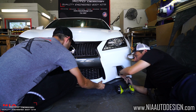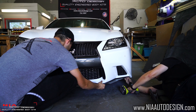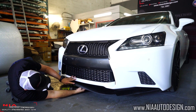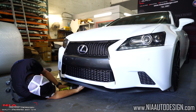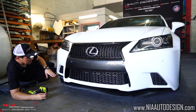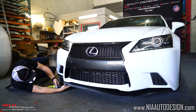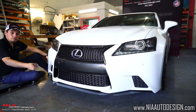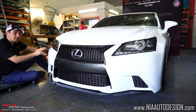Before you drill, make sure everything is spaced out and centered correctly. Once everything is centered, drill the other corner halfway. Once the two corner screws are installed, do the middle one — same thing, just follow the pre-drilled hole, put the screw in place, and self-tap into the bumper halfway. Once the corners and center are in place and everything looks aligned, install the rest of the screws through all the other pre-drilled holes. Once all screws are halfway in, grab the stubby Phillips screwdriver and hand-tighten every single one — hand-tightening prevents over-tightening and stripping the plastic bumper.